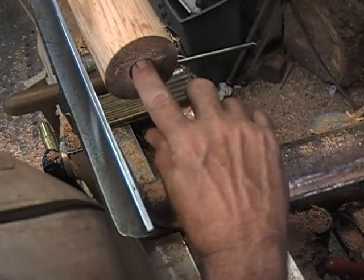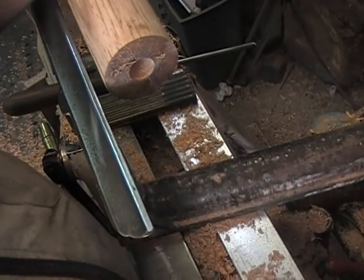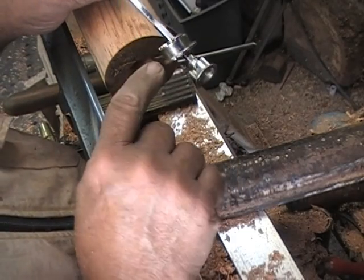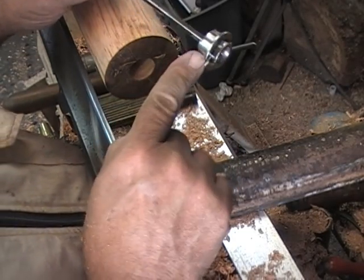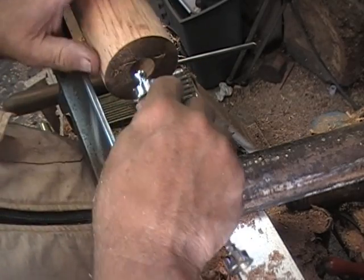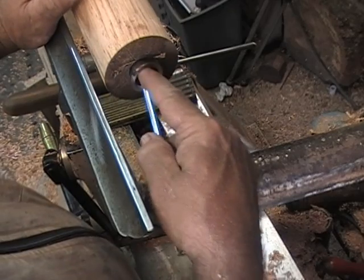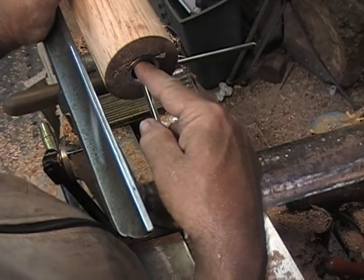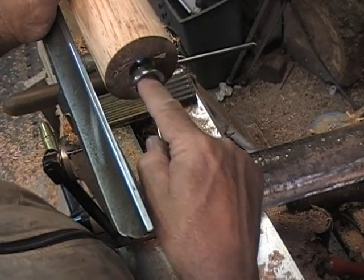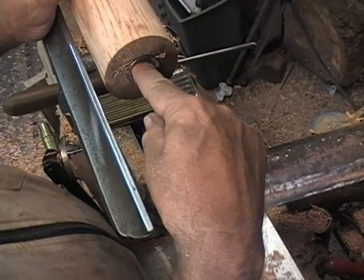Alright, now, we're talking about the 1-inch. Let me explain to you about the 1-inch. The instructions say 1 1/16. See that bell housing right there? That bell housing's got to fit in that hole. It fits in that 1-inch hole perfectly. So when you get the instructions and it says 1 1/16, measure that piece right there. If that fits in a 1-inch, you're home free, brother.